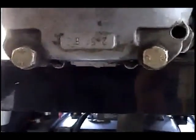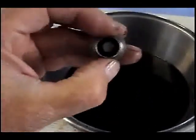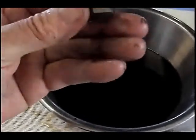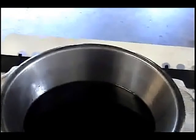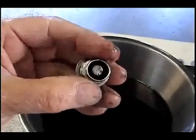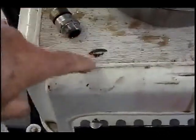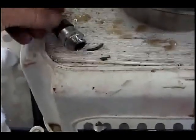We've let the gear oil completely drain and cleaned the plug. The little magnet inside was full of shavings — it shouldn't have that many shavings. There's also supposed to be a copper washer underneath this plug, but there isn't one, so I'll have to install a copper washer to stop any leaks. The top plug also needs a washer — the one I found is broken — so I'll have to replace that as well.